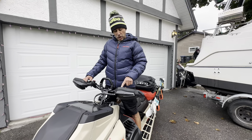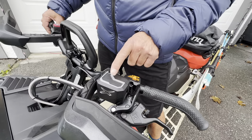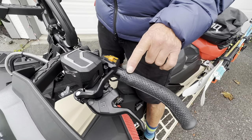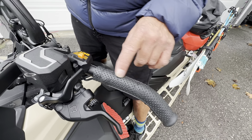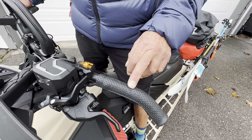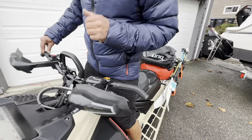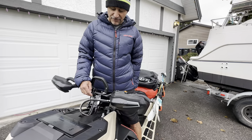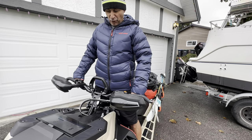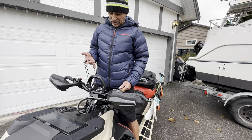The Summit X also does not come with a reservoir protector, so I add the Ski-Doo reservoir protector — I'll put the part numbers in the description below. It does come with the new adjustable brake lever, which I love. I've been adding the deep snow pro grips for four seasons now — these are super grippy over stock and what a difference. Different for everybody is their riser size: this comes with a 4.7 riser and I drop down to the 3.7, which with my boots on puts me in the perfect spot so I'm using the big muscles of my back, not my arms, when I'm carving.